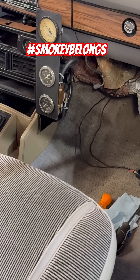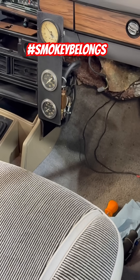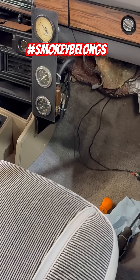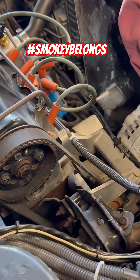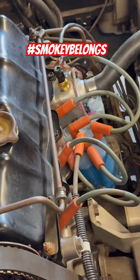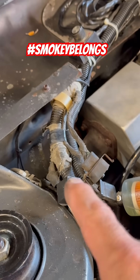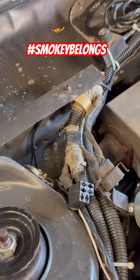What I did is I went to the gauges — there they are — and tapped in right there. I'm going to get my vacuum from there and still leave all the original gauges working, but do some data acquisition from there as well. Up here we have a cooling temperature sensor coming in this way, also an O2 sensor coming in this way, all coming up through here. I've got a tach wire coming from the MSD box, all going back up through here.